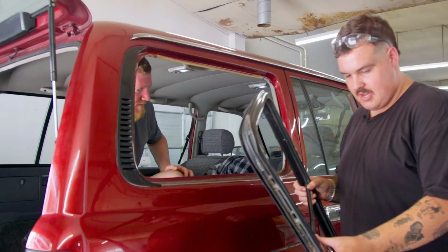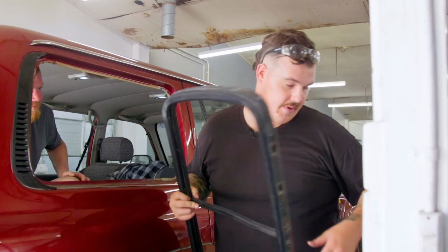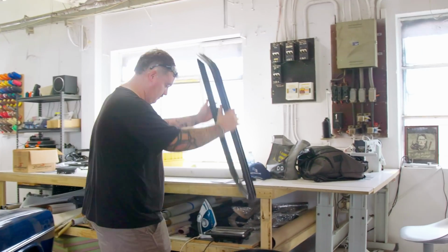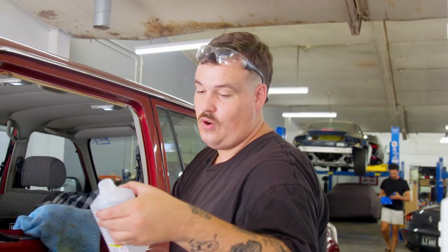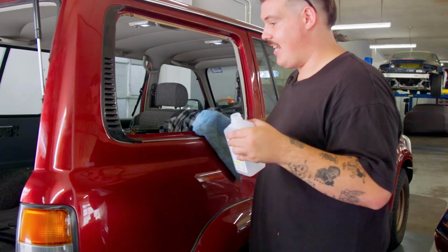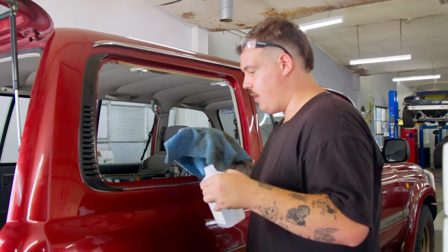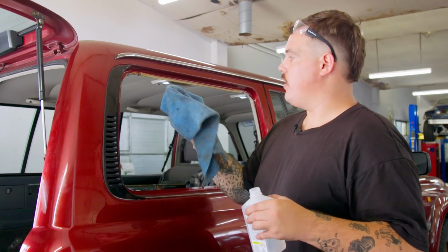Nice. Now obviously this window frame's in perfect condition, so what we're gonna do is follow me. This stuff right here is actually Bonnet Rain-X Rust Buster. Although there is absolutely no rust here, it doubles as a stain remover and cleaner. So basically we're using this to clean up the entire surface here, because we don't need 30 years of crud getting jammed in under the window seal. We'll run this around both sides when we get to it.